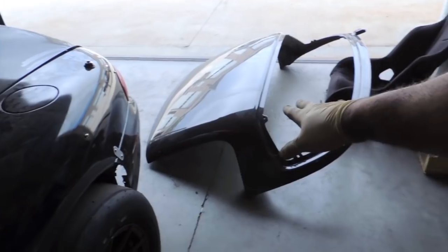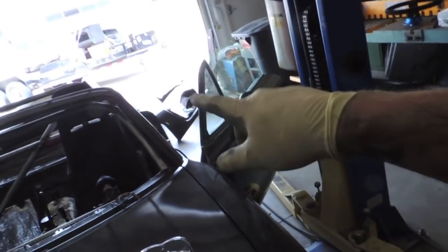Kind of feeling like I'm falling behind on this thing. I'm going to take all the carbon fiber parts to paint tomorrow to get re-cleared. In case you don't know, when you buy carbon fiber parts they're not clear coated — that's a clear gel coat that's not UV resistant. That's why carbon fiber hoods and trunk lids get chalky and hazy after about a year in the sun.